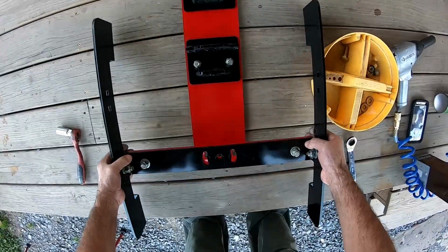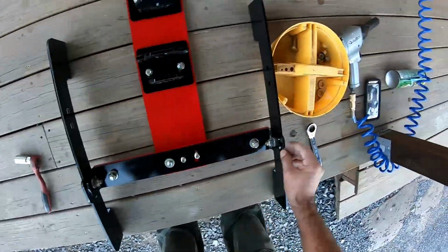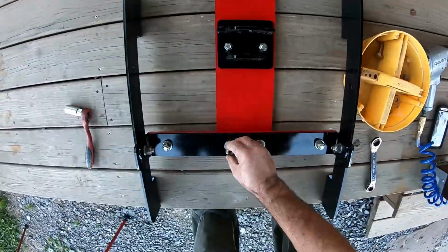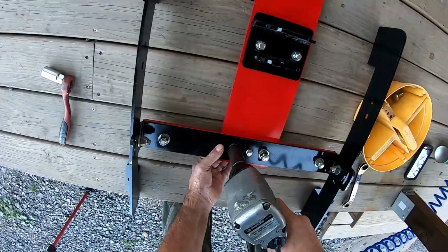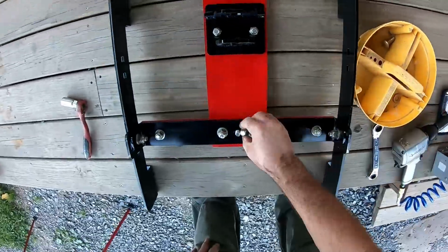With only the pivot bolts in the crossmember and armor facing down, place the stand crossmember over the 3 bolts. Install washers on the 2 outside adjustment bolts. The center pivot bolt does not need a washer. Install the nuts and tighten to snug temporarily.